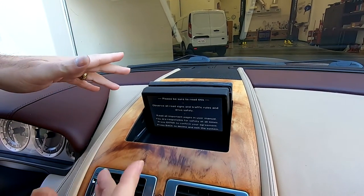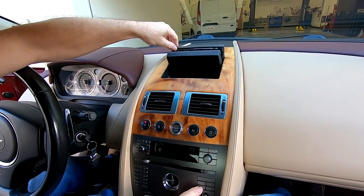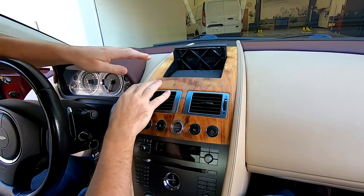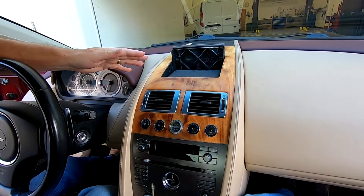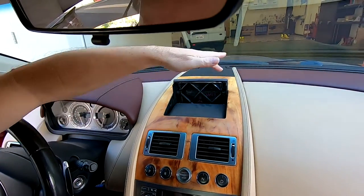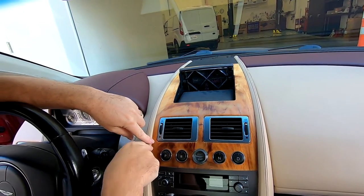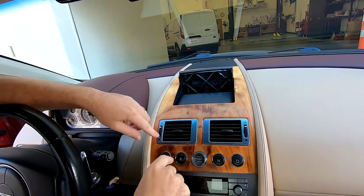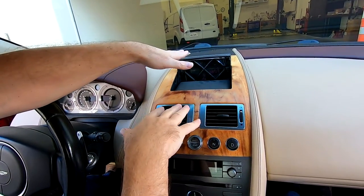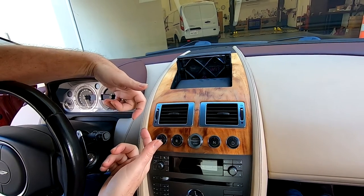So back to my car. I'm going to shut the nav screen off, but now the cover is going to stay up. The next thing to note — with the key off and all power off — is that this panel is held on by four clips: one here, one here, one around here, one around here. The clips are not perpendicular to the cover surface — they are designed for the whole cover to come out this way, actually mounted at angles underneath. So if you're trying to pry straight up, you're making a mistake because you're fighting against the sideways motion of the clip.